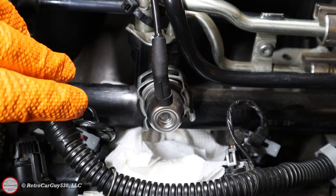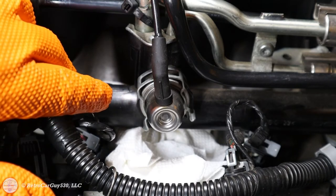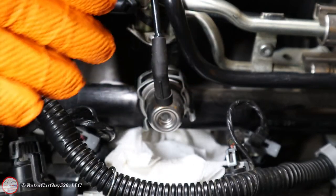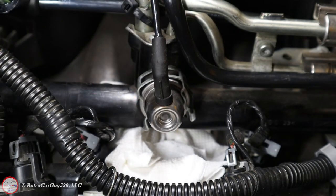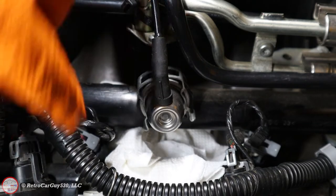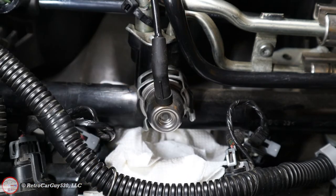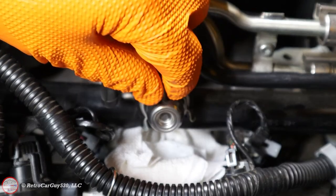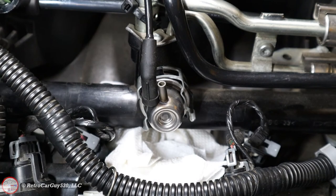What I want to do today is confirm I'm not leaking here, because there are a couple different failure modes. An internal diaphragm failure can be detected by pulling off the vacuum line — you'll have gas present, or while it's running you might see it percolate out. I've confirmed that's not happening in this case. The other reason I'm replacing this is I'm chasing a slightly low fuel pressure issue, which I believe to be the fuel pump based on other tests, but since I have the part I'll create the video. I've pulled some wiring harness wires out of the way and removed the coil pack connector to clear the view.